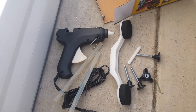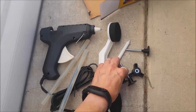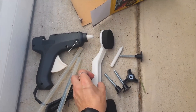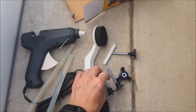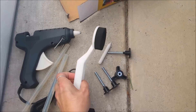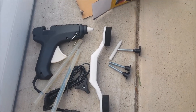The instructions in a nutshell: heat up your glue gun for five minutes, apply glue to the base that best fits your dent, let it set and then stick it onto your car in the middle of the dent. Let it set for eight minutes. Then put the base through the hole in the handle, put the turning knob on the other end, and basically just tighten the knob to pull out the dent.